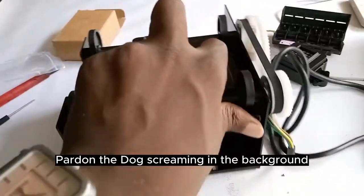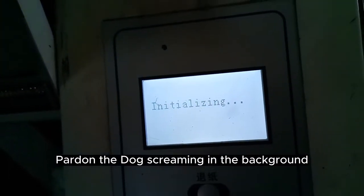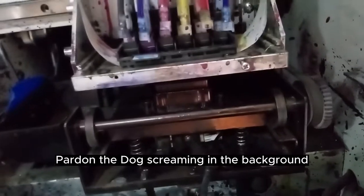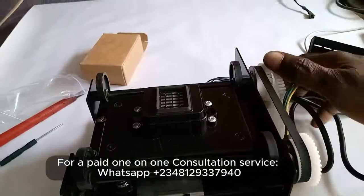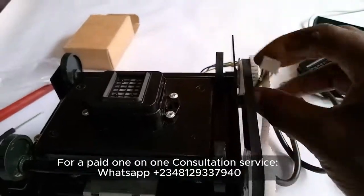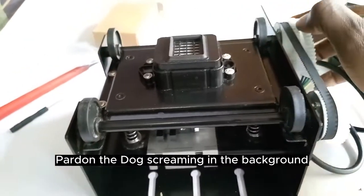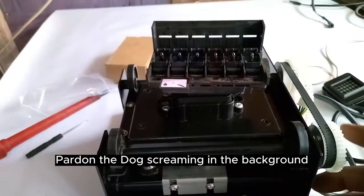This big bulky gear is connected to this motor at the back. This motor is connected via these wires to your board. The board is already programmed to control the motion of this up and down. So when you turn on your machine and it's initializing, it's trying to use this motor to control this movement. There are two reasons you might get a cap error — if this motor is damaged or if this sensor is damaged. The machine cannot cap properly, and therefore your printer head cannot work properly.